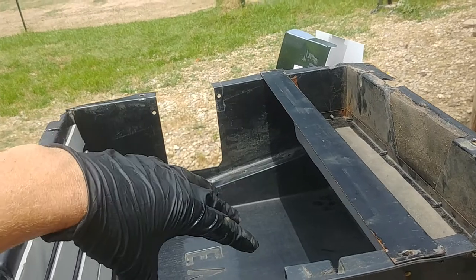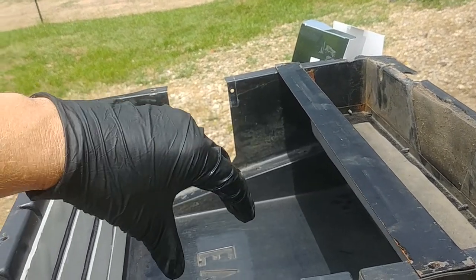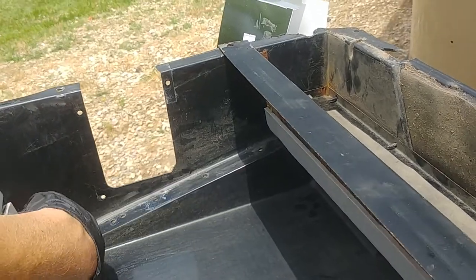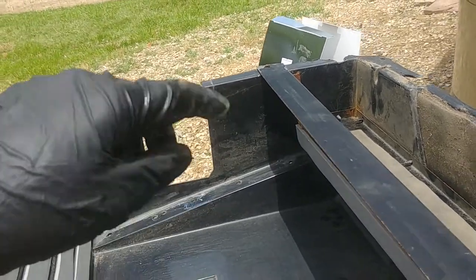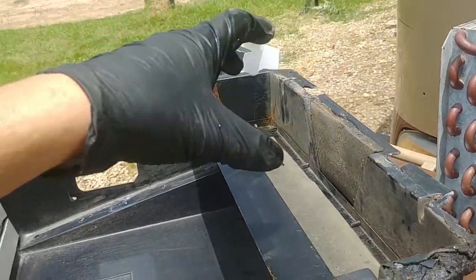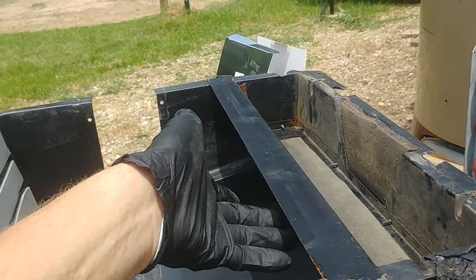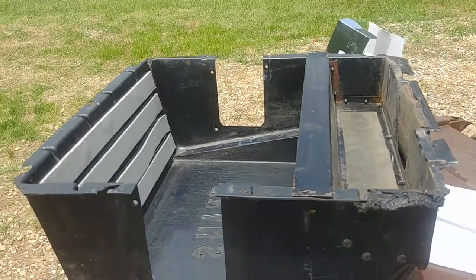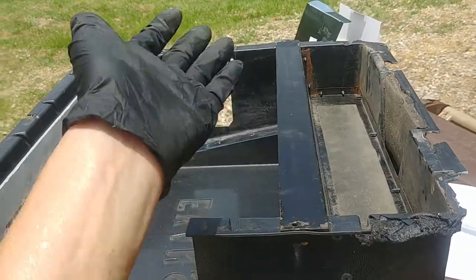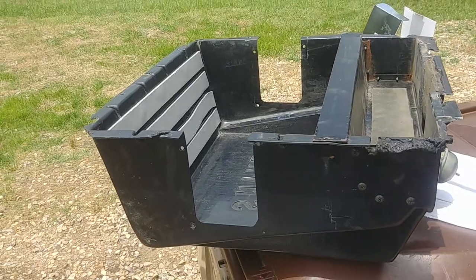The coils will be sitting in here when you pull it away from the wall. All you got to do is lift up the coils — they're free. Of course you've got to undo all the screws besides the ones I just showed you. You lift that coil up and set it over this lip here, and all this stays together. I took out every screw and ended up having to put it all back — you don't have to do that.